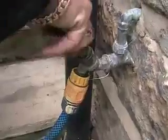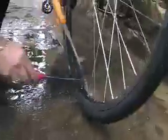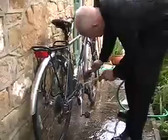You've applied wash fluid to the bike and cleaned the chain. Now rinse off with water — use a garden hose, not a power washer, or you risk forcing water into bearings, even sealed units.